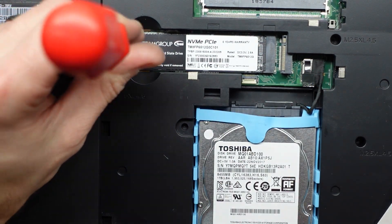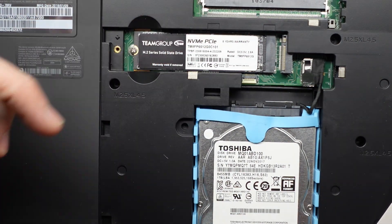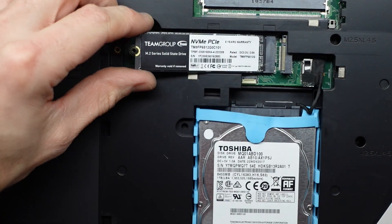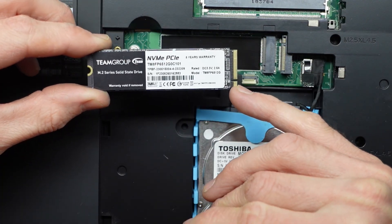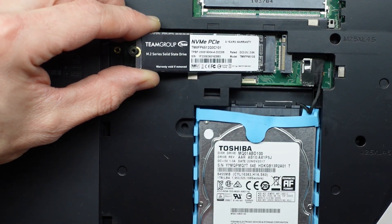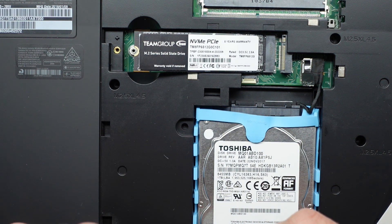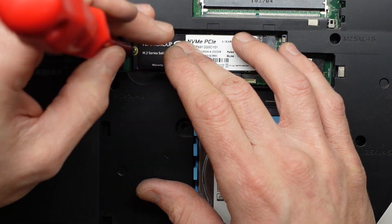Slightly odd, but as I said I'm removing the SK Hynix to install the new one. As you would have noticed, I did have to match up the teeth. So I'll lift that out, line it up down here, put it in at about a 35 to 45 degree angle — it sits up like that — and lock it down by pushing it flat and screwing it back in.